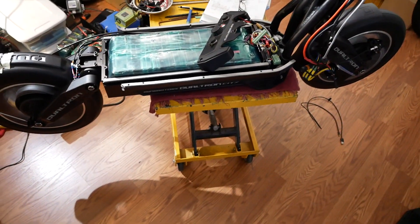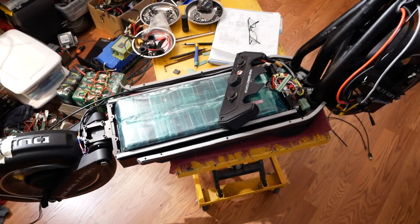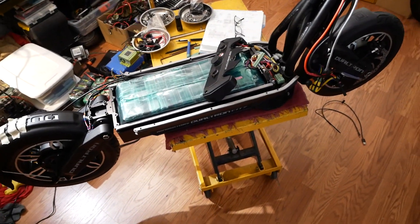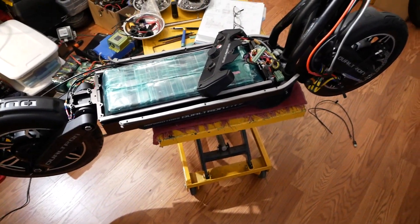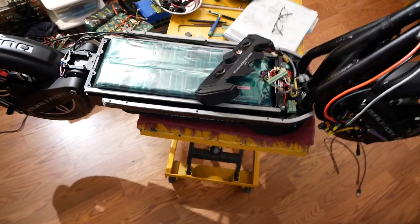There are some slight differences between the front and rear controllers and how they make the motor respond, but it's the first time all this has worked together. I do have a problem with the controllers — basically they're not talking over CAN bus.